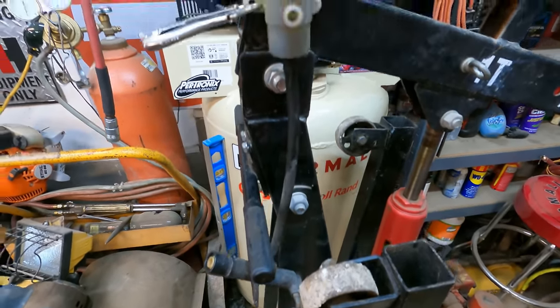Well, I'm having a bit of a rough go of it here with this hydraulic clutch. Yeah, it's one of those things that should be easy, and it's just taking forever, and it's not going right. So, after you install the clutch assembly as a whole, with it already bench bled, you're supposed to be able to fill up the reservoir, and then go down on the transmission. Down here on the transmission, you're supposed to be able to crack loose that bleeder right there, which I've done. And as soon as you crack it loose, everybody says the fluid should just start flowing from the reservoir. And then you're supposed to flush like two reservoirs full of fluid through it to get all the air bubbles out of the slave cylinder, and then just close it up. Should be as simple, easy as that.